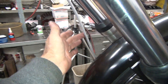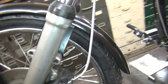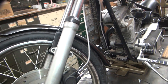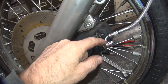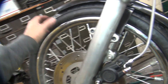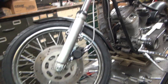This one here is obviously going to be able to bend and bow out of the way, so it shouldn't be a problem. Everything is in there pretty good. Proper brake line mounting is very important - if you do it wrong it will tend to make things break. It will either make them start leaking, or worst case it pulls these things off and splits them right here and blows the line off. It helps to do things so you don't have binding on it. I think we got what we need on that.